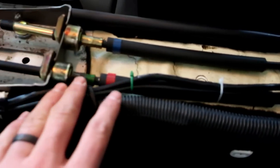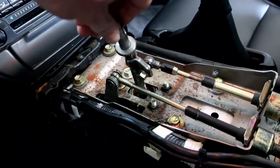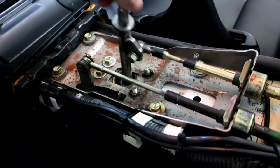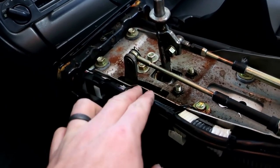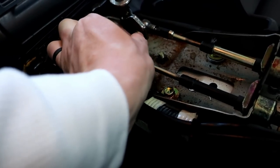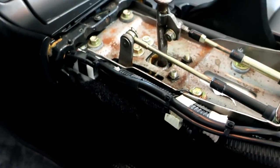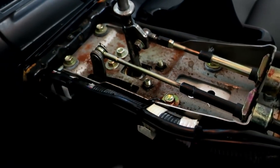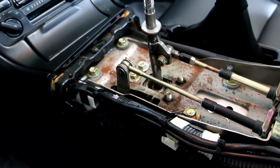I've got the center console out. This shows you all your shifter cables — you've got your side-to-side cable and then obviously the forward and back cable. What we have to do is take this panel out because we need to put a drop plate in. We also have to unbolt this, and it's supposed to be loose like that so you can see how it moves back and forth — you need to be able to rotate it. There are six bolts here to remove, and I'll show you where the solid shifter bushings go when it's all done.